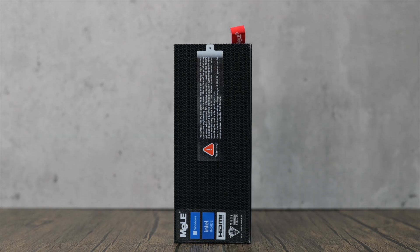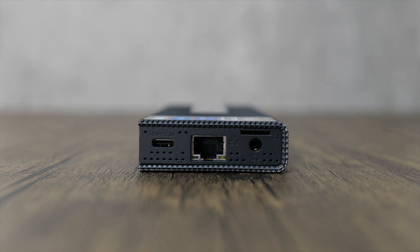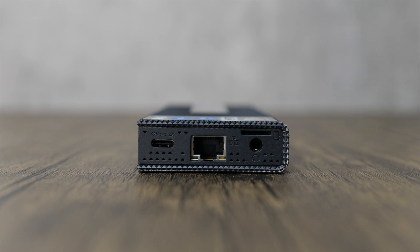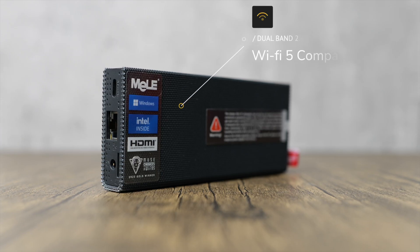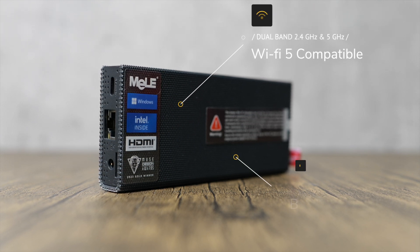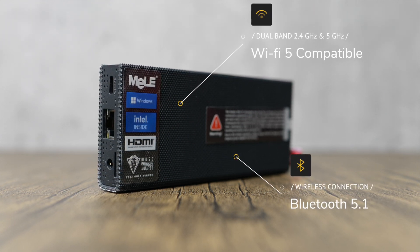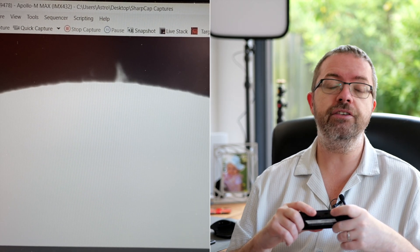You can also get this mini PC with 128GB or 512GB options, but like the RAM it's not upgradeable, so you need to be clear on which model is the best fit for your use case. The microSD card slot supports up to a 2TB card, which gives you more options. For wireless connectivity you have dual band WiFi 5 running at 2.4 and 5GHz, and Bluetooth 5.1 as standard. For my imaging sessions these specs are more than enough to easily remote control my rigs as well as take both long and short exposures with my cameras.